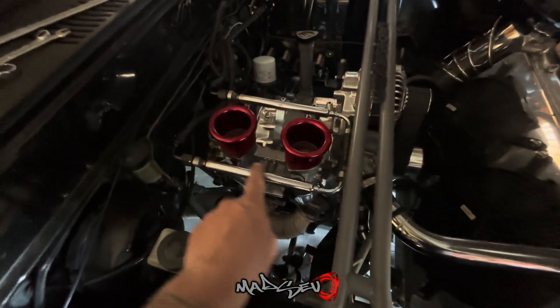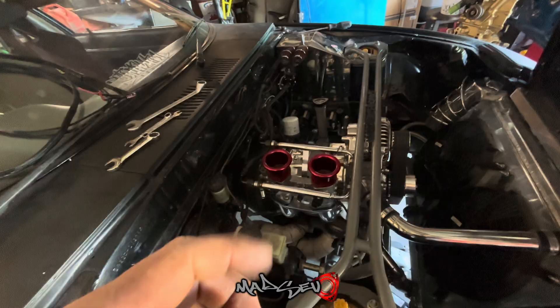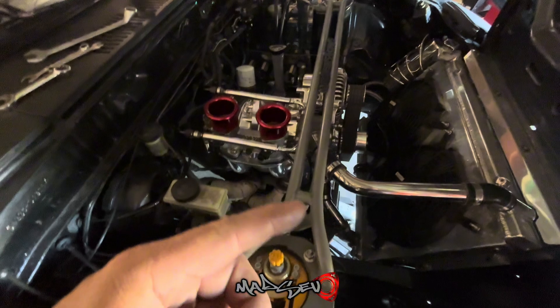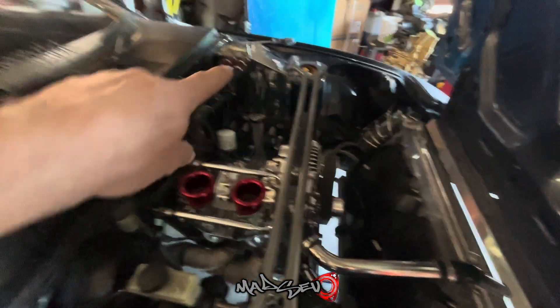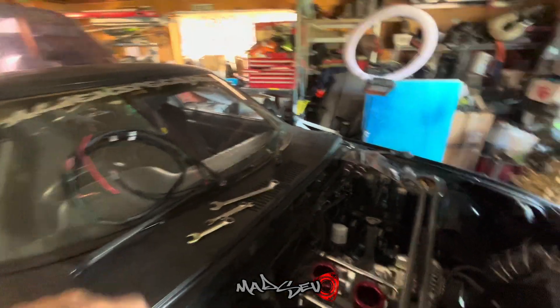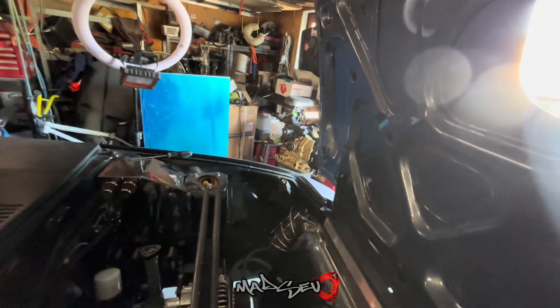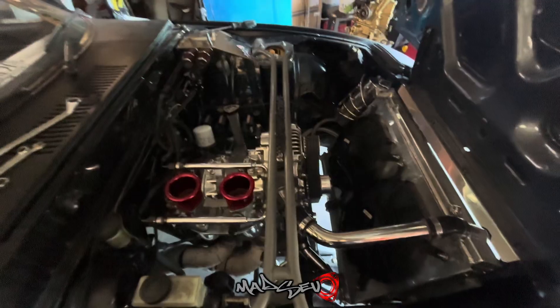So what I'm going to do is — in my last video you saw these fuel injectors, I think it was this one and this one were leaking quite bad. I've found an O-ring kit right here, and I do have new seals coming, but I'm going to try these first and see if I can stop that leaking so I can fully test the fuel lines and the fuel pressure rig. And over there I just got the 12A club car engine back, so during the week we're going to be dabbling with that as well.